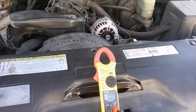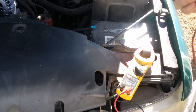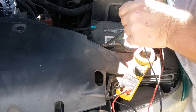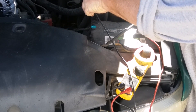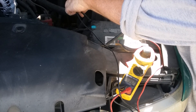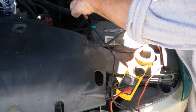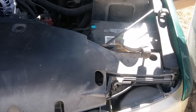If it's less than that — I've run alternators showing 13.5 before without a problem. You can also check your alternator by taking the red lead to the hot terminal over here. You should be getting 14 or so — there you go, 14.2. So it is working. It's not the alternator now because that's a new alternator.